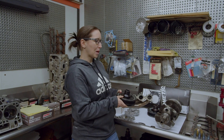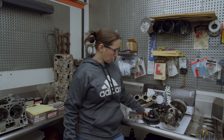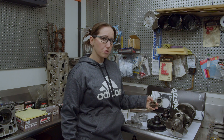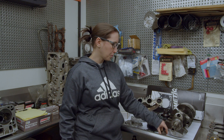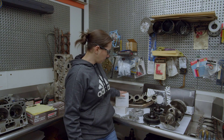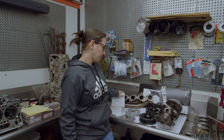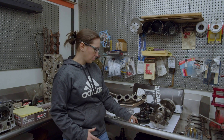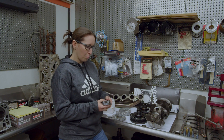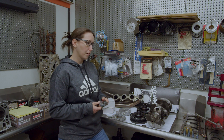You can see inside the crank gear all the marks from the wobble and welding, and on the balancer itself it was starting to weld to the crank gear as well. We're currently working with a crankshaft company out of Ohio to come up with a solution. For 2022 we've got a new balancer ready and we're going to try a different brand crank gear — a Triangle Speed gear sent to us from NPR Racing Engines. When taking all that apart, definitely look at the oil pump gears.